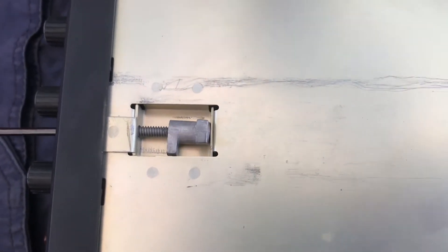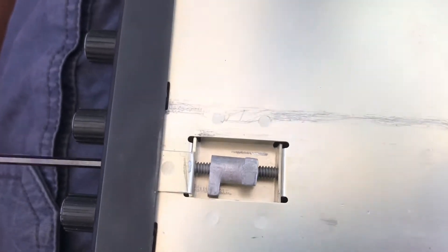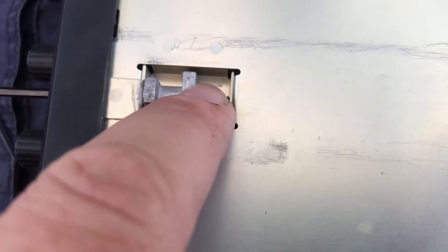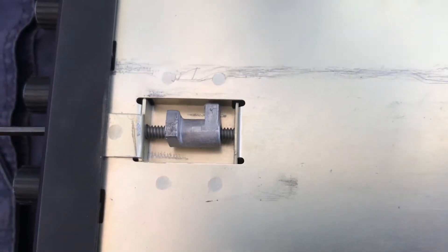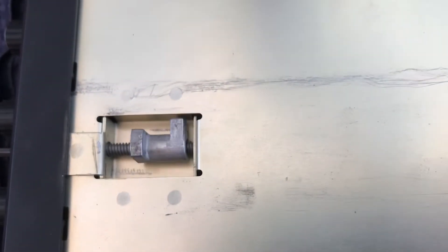Here's our old one that we're removing. Here's the little tab on the bottom — this is the little screw on the bottom. When you loosen it — I'll put it back in the tightened position as if it was installed — this tab that sticks out here locks it into the tray. So when you loosen it, you hide that tab, you push this tab on the front of the tray, and as you draw that, it helps push the radio out. If you have a hard time pulling it out, you might need to wiggle the bolt back and forth to flip the little cam there.